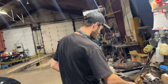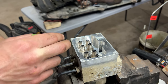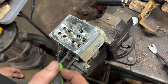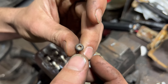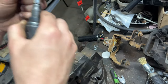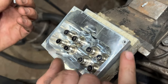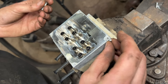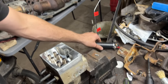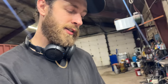Made sure to clean around the area — you don't want any dirt getting in. This unit I won't be using, but on the one that's in the truck I cleaned all the dirt off because this area needs to be super clean. The little bolts are T20 Torx. I had one snap off due to corrosion, but luckily it snapped off sticking out a bit so I got vice grips on it, used my mini torch to get it nice and hot, and was able to get it out.